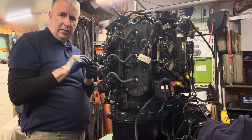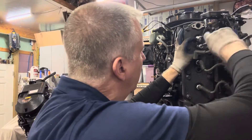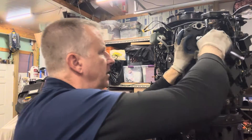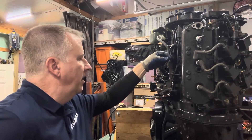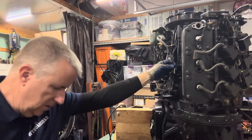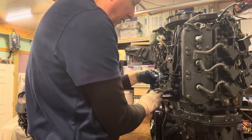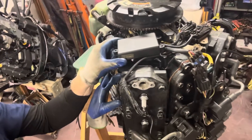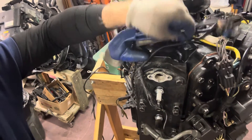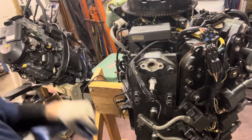We're just going to do a process of elimination little by little. Now we have our sensor mounted for this side of the head. We can tighten up the support with the ground wires. We see these two wires that get snaked over the top and they go right onto our switch here. Connect those — it's just a switch, so it doesn't matter which one goes where. This module gets mounted on the top, there are three holes for it, so we'll get the three bolts for that. This module also has a ground wire that'll get put underneath and secured with the bolts.